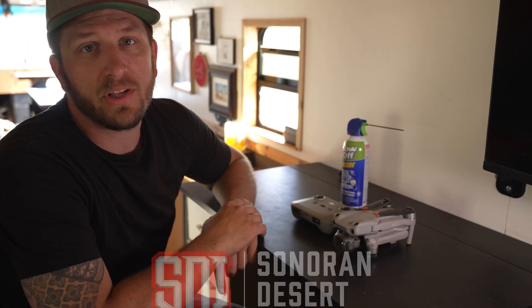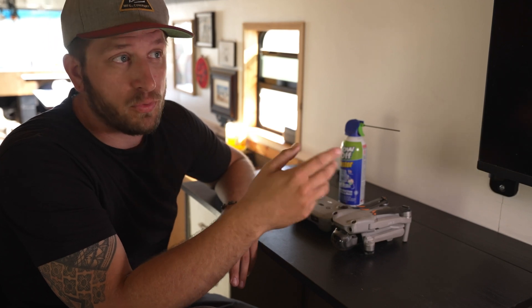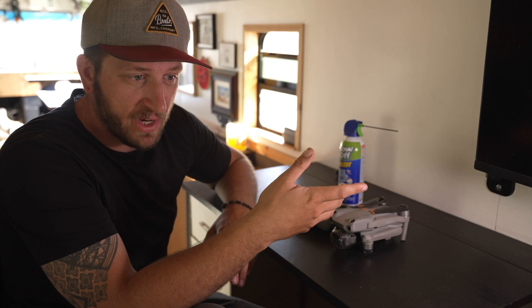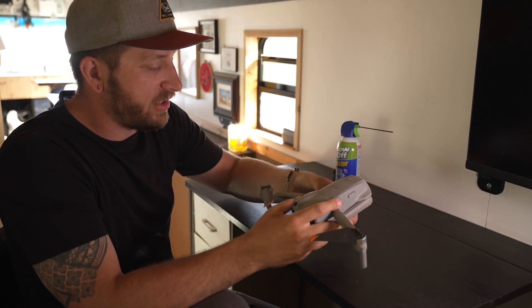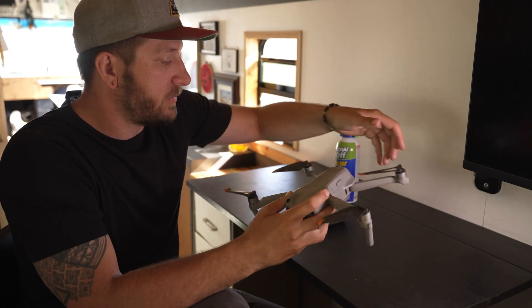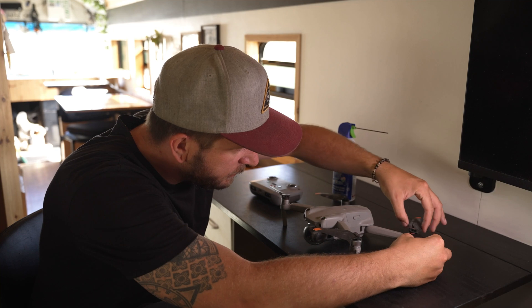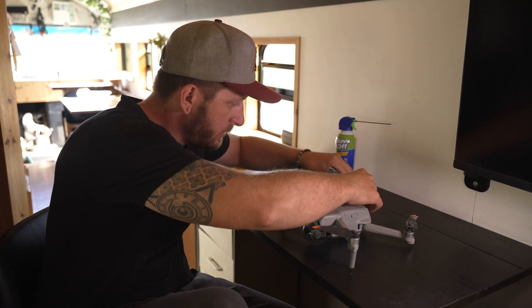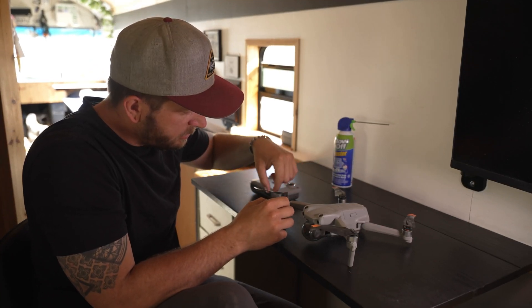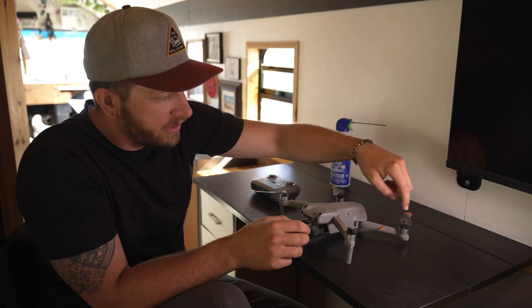Today I'll be doing some routine maintenance, but it's quite a bit earlier than planned. I had the drone sitting on a launch pad, a large gust of wind came through and blew it over into a pile of sand and small pebbles and rocks. At that point, before takeoff, I noticed the motors themselves couldn't move. We have to do a full motor clean. There's quite a bit of debris in the two rear ones and the front one, so we definitely have to clean these three.